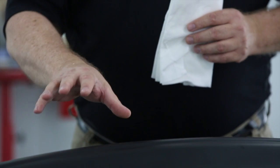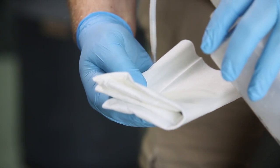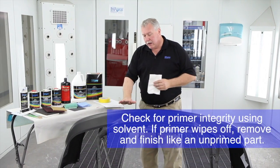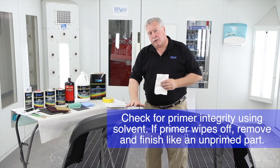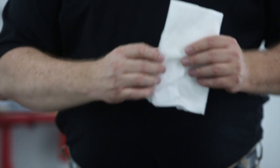The other thing you might want to check is solvency. Take a good lint-free rag and some solvent cleaner, wet up the rag, and then hold the rag on the primer for a little while to see if it dissolves. If the primer is good and sound, you won't see it come off on the rag.